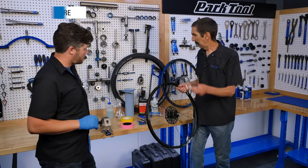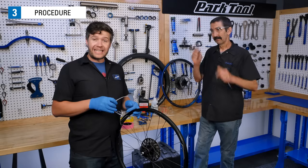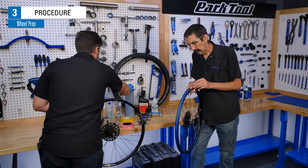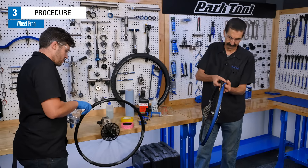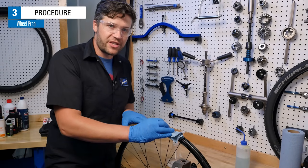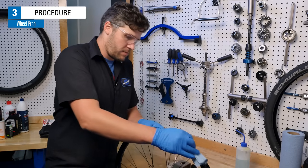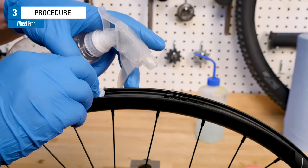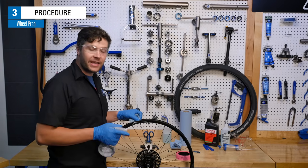Now that we've got our parts, supplies, and components, let's get started with some cleaning and wheel prep. If your wheels came with an inner tube and a rim strip, remove it — this strip is not intended to provide an airtight seal. Even if your rims are new, follow the same cleaning procedures, as there can be leftover lubricant or surface prep from the factory. Clean up any dirt or contamination on the rim so that the new tape can adhere nicely, using a lint-free cloth or rag and isopropyl alcohol. Once your rim is clean and dry, it's time to start taping.